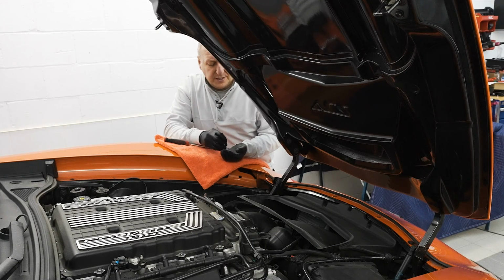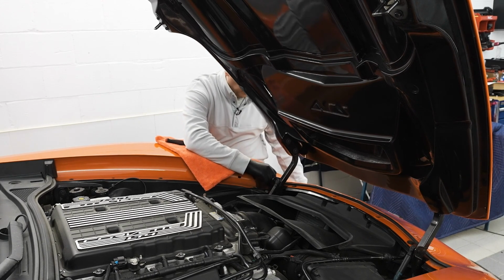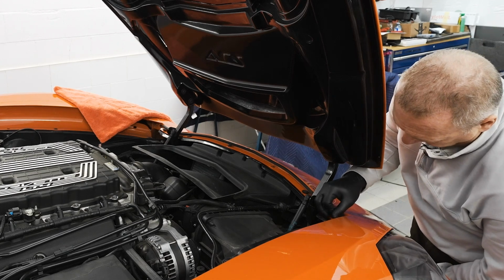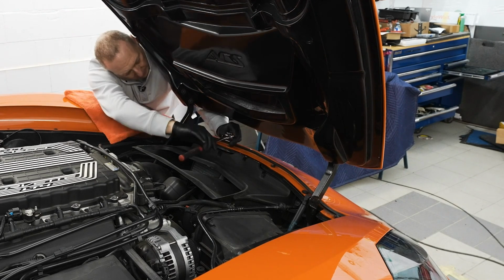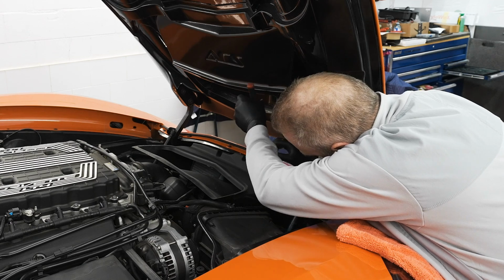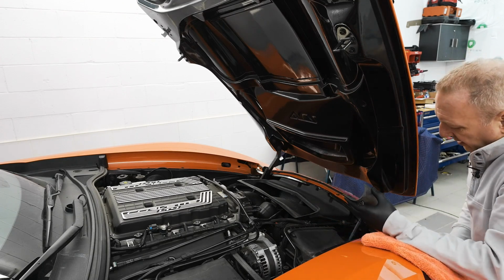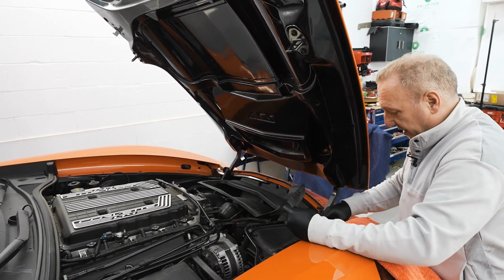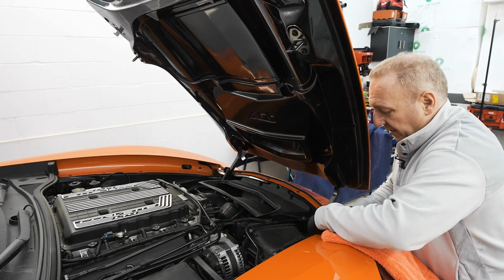Next are our T30 bolts. And there are 4 provisions for them. Don't forget your hinge molding plate. Little nail goes in the front, and then this clip snaps into the fender, working around your latch cable.